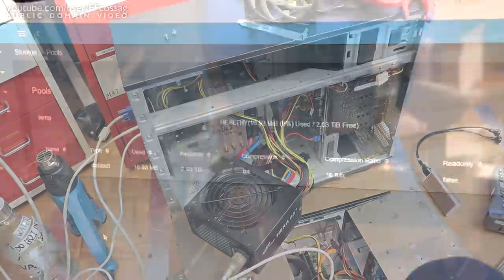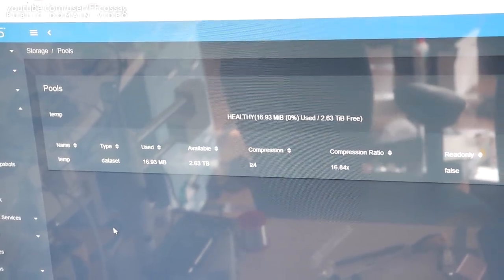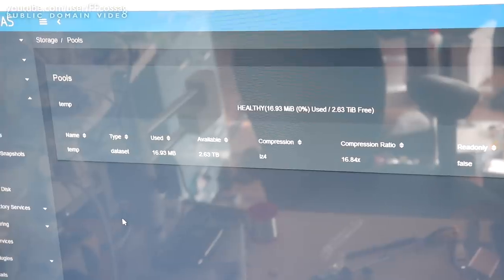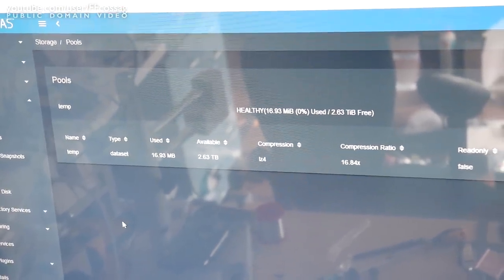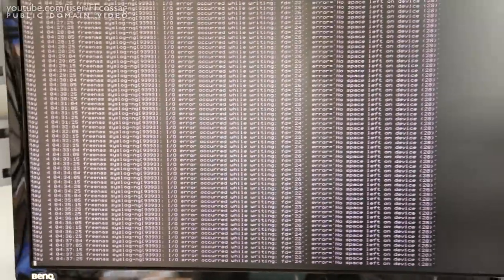Today has turned into tomorrow — last night before bed I put all the new drives into one giant mirrored array and ran a DD to write random data to all drives until they were completely full as a burn-in test. Overnight we wrote 3 terabytes of data until 100% full. I checked all the SMART data this morning and everything was fine, so I'm confident we can put these disks into service with no dead-on-arrivals.